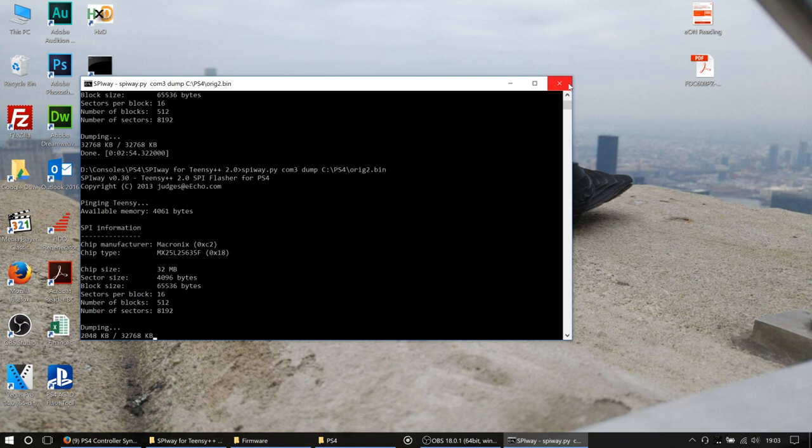But essentially what we do is, once we've split out the information that we need from the overall dump, we compare all the dumps together. So effectively it confirms that we've got the exact same dump several times over, byte for byte. The chances of 2 or 3 dumps being corrupt in the exact same fashion would be, you know, probably better chance of getting struck by lightning. So that's why we dump it several times. It's partly because we need to, but we don't actually need to for the repair side of things. We just need to do it for a sanity check.